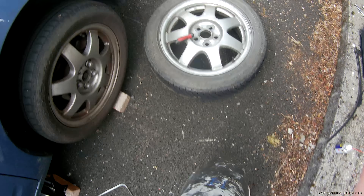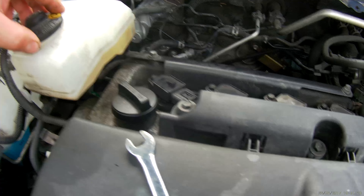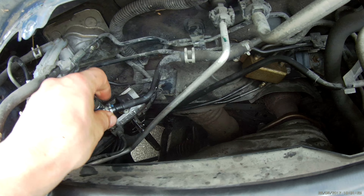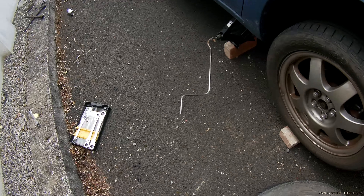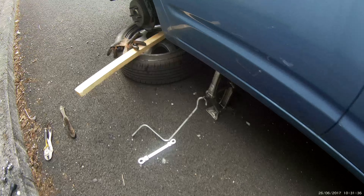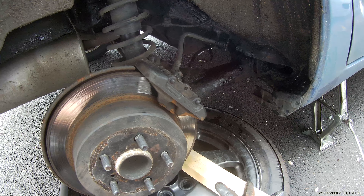They cost about 130 euro, so it's not too bad — about four or five hours work. Don't forget to empty your brake fluid tank — open this and this and the brake fluid will go out. You can check videos on YouTube on how to bleed the brake fluid on a Toyota Prius. It's quite easy — you just need to put the car in diagnostic mode. Thanks for watching.